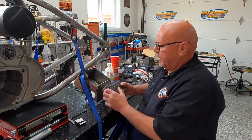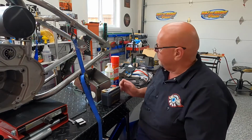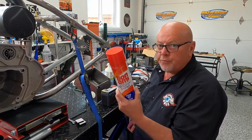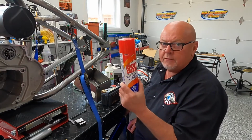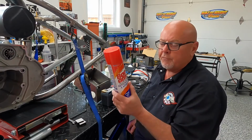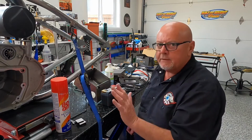Before I put the foam on, being that it has an adhesive back, I'm going to clean the surface where I'm going to attach the foam. And that's what I wanted to share with you. One thing I like to use, Bon Ami does a really good job of cleaning. I've been to 3M vehicle wrap seminars. This is the only product there that wasn't a 3M product. And this is what a lot of the installers recommend for your final cleaning before applying the vinyl. So Bon Ami leaves a very clean surface. It really takes off anything that's there.